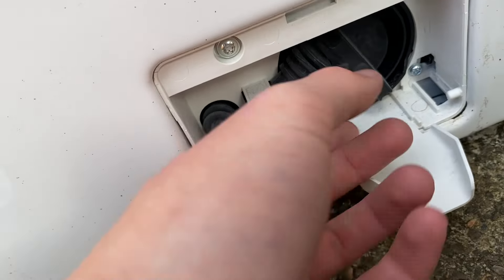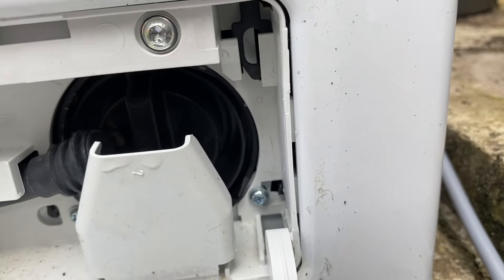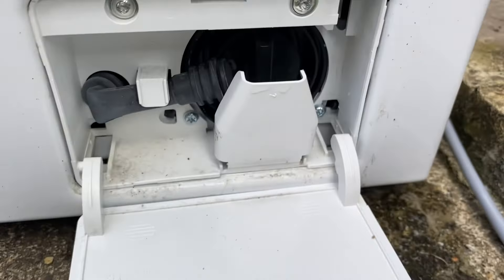Then you put the hose back in, push up the bigger retaining piece, and put the door back on by pushing it in — it clips back on like so. You can also open the door on this model: if you get a flat-blade screwdriver you can pull this little lever down and the door will open. So if your door is stuck, give that a go. I hope that was helpful, thanks for watching.